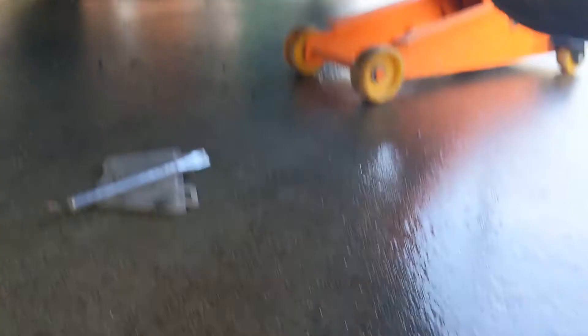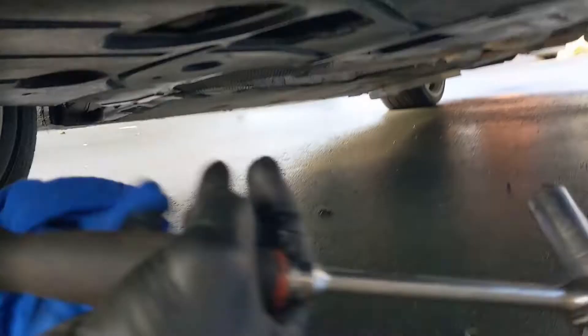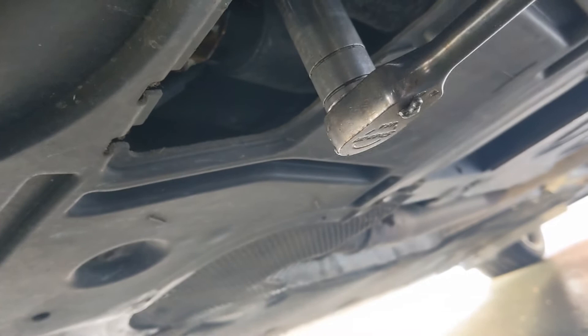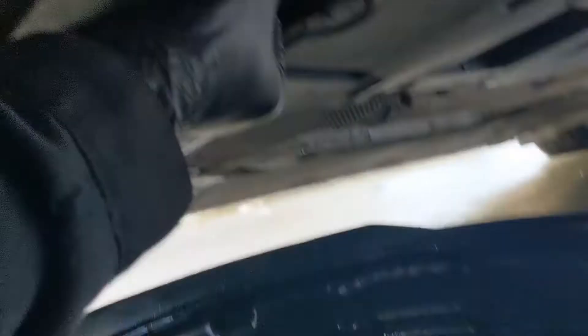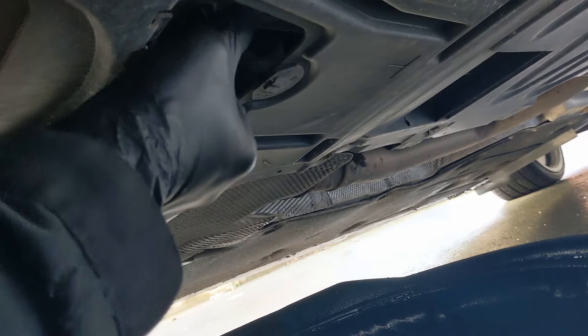We're just down low on this now. There's a bit of a flap there that you need to swing out of the way — I'll just use the chisel. I've got a 17 deep socket. I'm just going to crack it. It should be nice and warm because I've done about 20 miles getting into work and running some errands, so it might warm my hands up. Lovely — I like that drain. Do the filter, put a new washer on that as well.